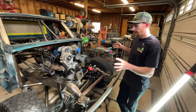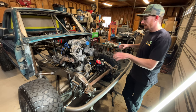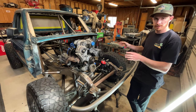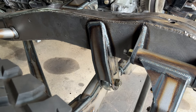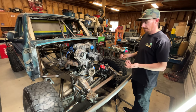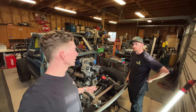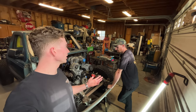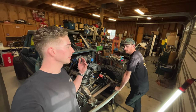When I got the beam kit together, the first thing was getting the beam mounts tacked on the frame. Once on the truck with the radius iron cross member in place, the beam mounts were just a little bit off and I had to play with them to get the beams close enough together. Just trimming the beam mounts a little bit to get everything working, plus a little trimming on the radius iron cross member to get the width correct — that was pretty much it. For the next one we're going to get a scan of the frame rail, which is way more accessible these days. We say 'on the next one' a lot, but that means we're progressing and finding a better way to do things.